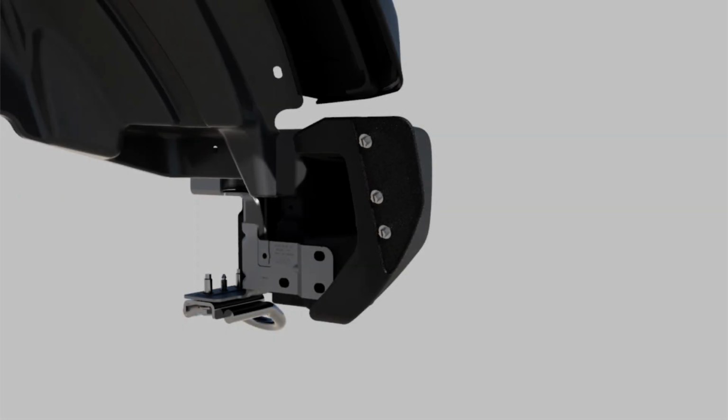Note, in some cases, your plastic rear bumper may have OE flare extensions installed in it, like the one pictured here. If this is the case, you may be able to use the holes used to install the flare extension to secure your mud flap. Check to see if these holes work with your flap. If not, proceed to install the mud flap as shown previously.